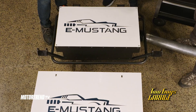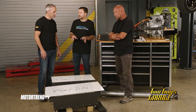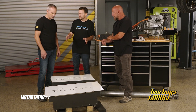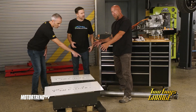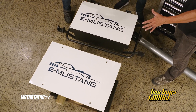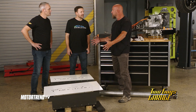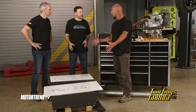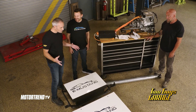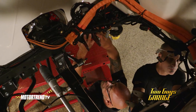Inside these boxes we've got the batteries, the battery management systems, the wiring, and cell taps that can monitor the temperatures, cell resistance, and voltage of each individual cell inside the battery. You've also got a whole frame here — weight distribution. Think about that because batteries weigh a lot. If you're heavy in the front, you can start to 50/50 that car out better than what it was from the factory. Every car and kit we build, we try to even out the weight better than we found it.